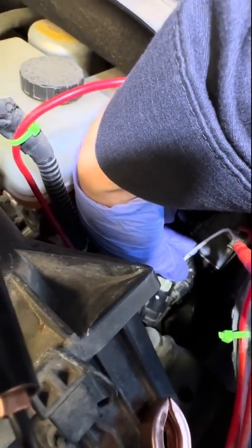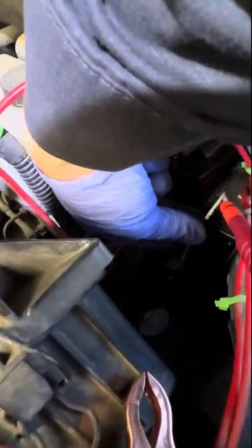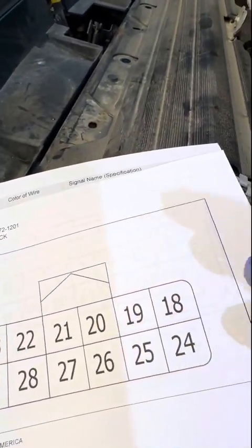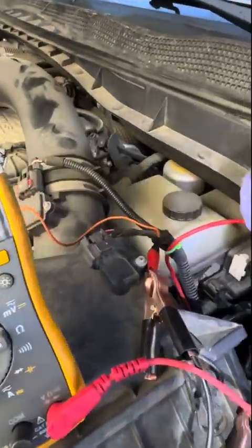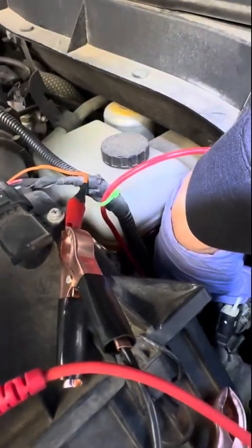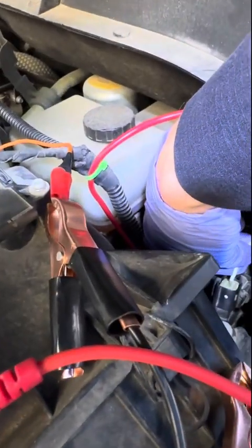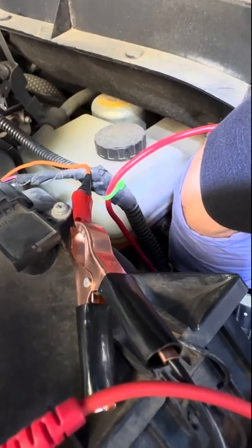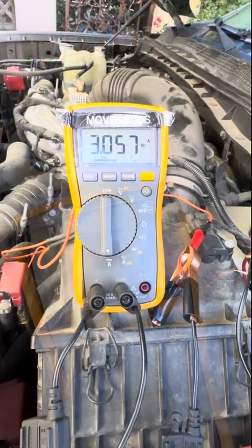I actually have one here that's higher than the rest — twice as much resistance, 1.4 ohms. That's terminal 24, and that's glow plug number five — 1.4 ohms compared to the others at half an ohm each. Might as well check them all: half an ohm, half an ohm, half an ohm. So number five is not okay, but we'll put a load on it just to double-check.